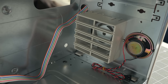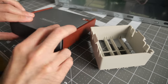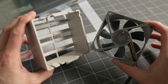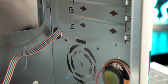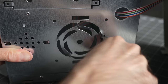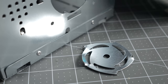This case lacks a spot for a rear fan, so I wanted to at least install a front one. This plastic cage can be unclipped to reveal the air inlet. I picked up a basic 80mm Noctua three-pin fan — I wasn't too worried about noise since the rest of the machine will likely make a racket anyway. The cage serves as support for long expansion cards and lets you snap the fan directly into it. However, the inlet in the case itself was a different matter. More retro-hackery was in order — I unclipped the front bezel and simply chopped out the fan grill with an old pair of cutters. It doesn't matter if the results are ugly since you'd never see it with the fan in place and the bezel on.